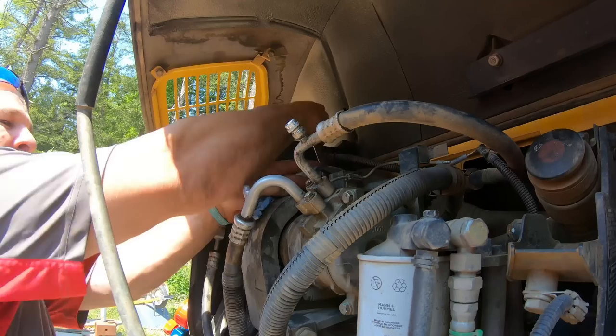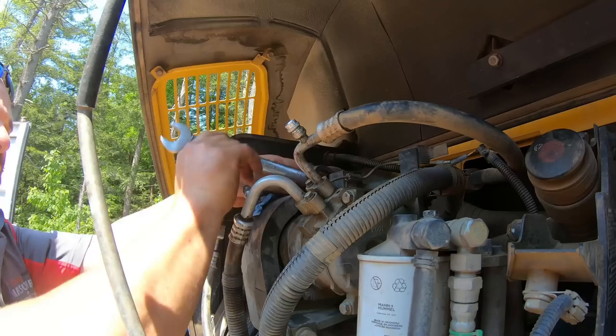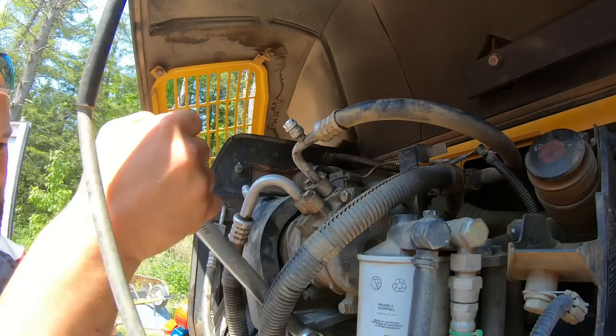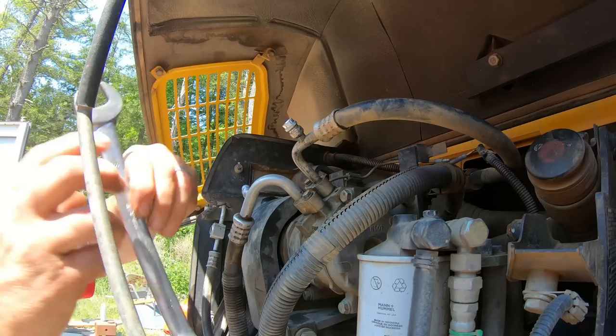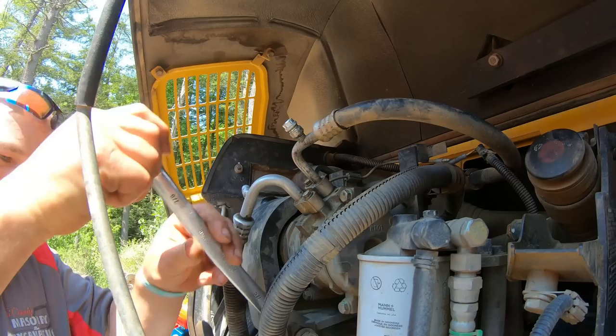Let's get this thing off. We've got a little shroud here — this is the AC I'm going to tackle first. Everything is already pumped down and all the 134a is out, so we don't have to worry about anything spraying us. This is just a cover, and we've got two lines there — pretty simple. Good thing it's not the alternator, because that alternator is on the back side all the way down in the front of this motor.